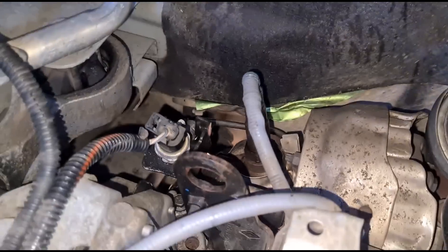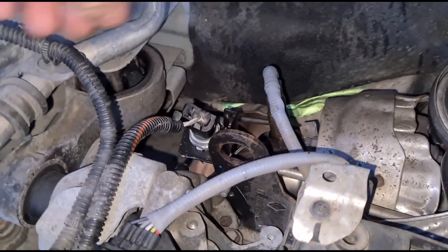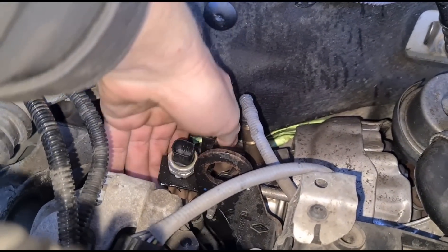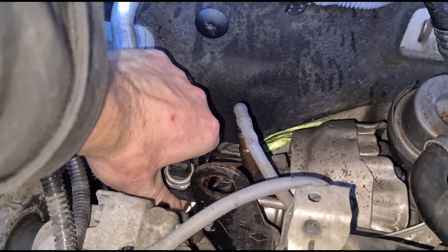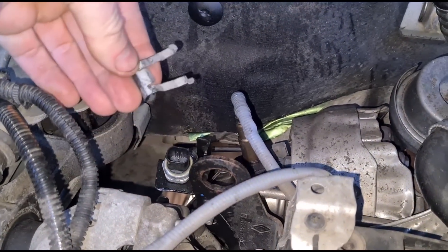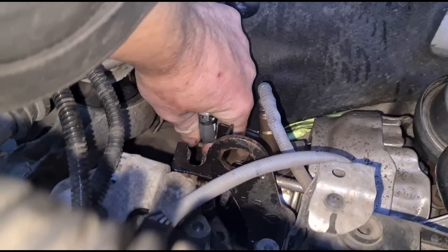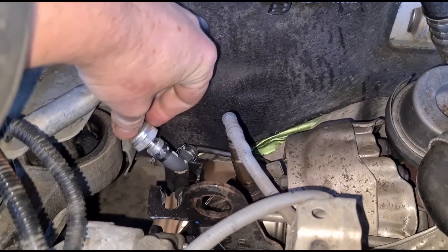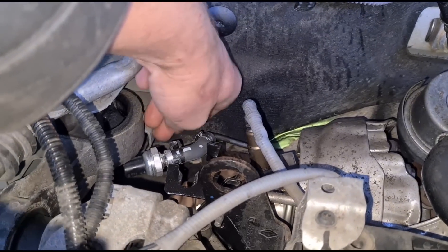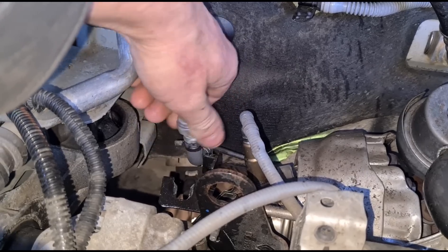I'm going to try and get the camera down there because I can't physically see much from up here. I can see the sensor is sitting a bit wonky — someone's had it off. I'm taking the plug off. Someone's wedged the clip in sideways. The tube is not burst — I just need to flex it back a bit so I can see clearly. The tube looks okay; looks like someone may have put a new tube on it. The sensor is not giving any reading whatsoever, so something is going on there.